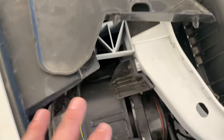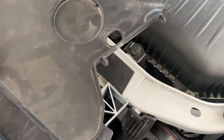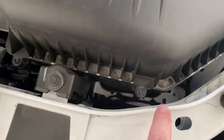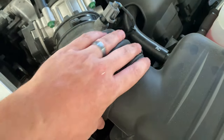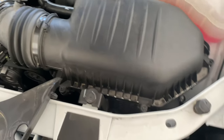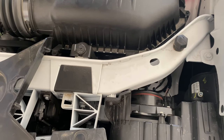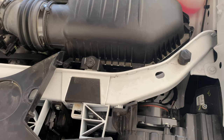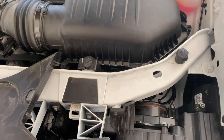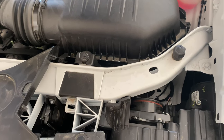You'll want to get this plastic cover off — you can see it's just right here, it just snaps off. And then you have a bolt here, here, and then clips in the back. We'll also unplug some of the items up here just to make sure we can get all of this off. We'll jump into it and I'll show you guys some comparisons to the boxes here in just a second. I'll probably put it on time lapse for most of the part. Thanks for tuning in, guys.